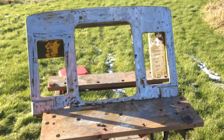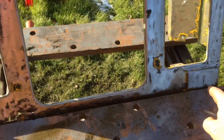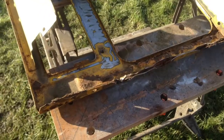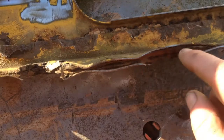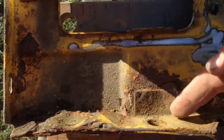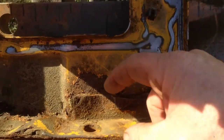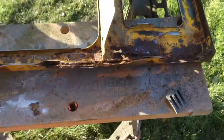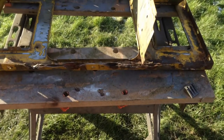That's the front grille of the Land Rover and I'm just going to lie it down — we're going to be looking at that bottom rail. This is the inside and you can see there's loads of rust that's expanded into all of these little joints here. I think the fix is basically to cut it off at that join. I'll be able to get this piece off separately. You can see there's an additional piece here, and then basically weld a section on from that end all the way through to that end and then just drill the holes as required.